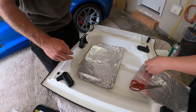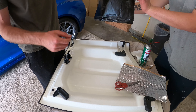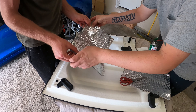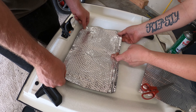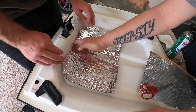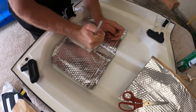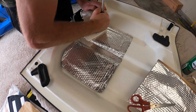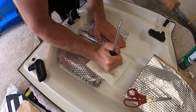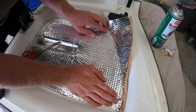We'll do the whole thing — heck yeah, that's great actually. Now peel that back off slowly, take it like this, hold it, lay it in there and set it — taco it up so it'll still lay in the middle right where you want it. Set it here first and then just work it down. The shiny stuff stays — it's just a normal foil, it gives that butyl rubber some strength. GoPro's about to die, two percent — we'll see you in a few.